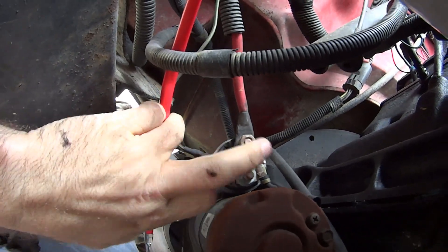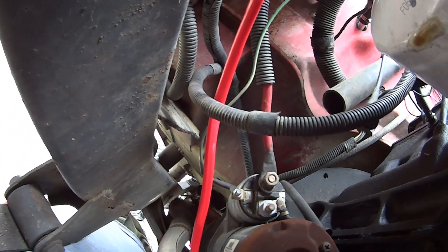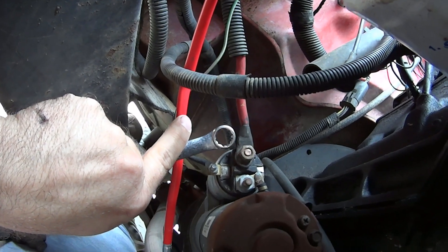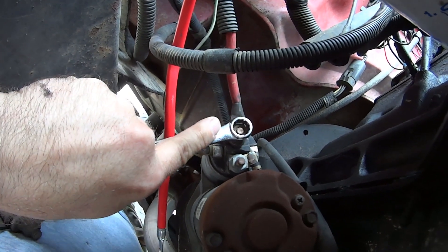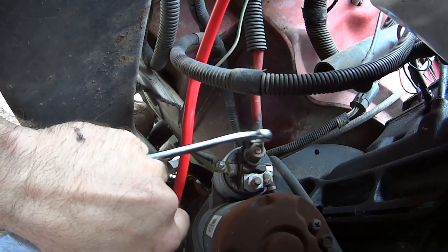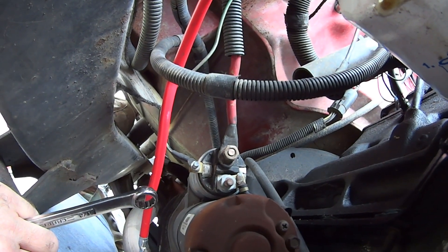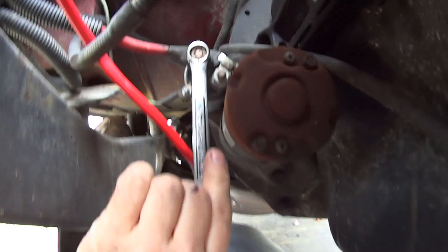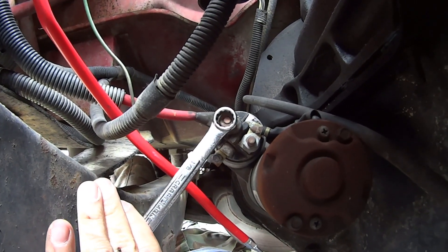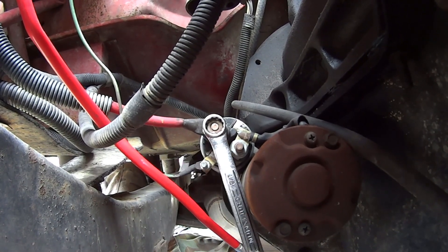This right here has got to come off. While I was at it, I took the new cable and strung it down here to save myself a trip. Notice I'm hitting the frame here - that is the reason I tell you guys to take your negative side off first. Whenever you're doing any kind of mechanic work, disconnect that negative cable, because at any point in time if you short out against the frame while hitting a hot post you're going to cause sparks, and sparks can cause damage to other things. I'm going to get this thing off - can't do that and hold the camera both.